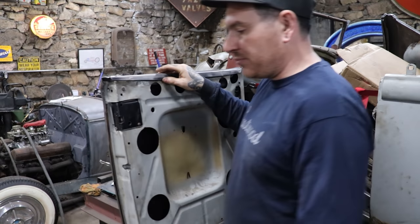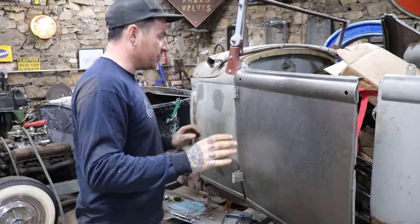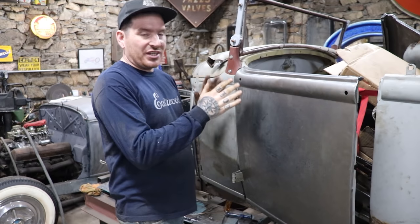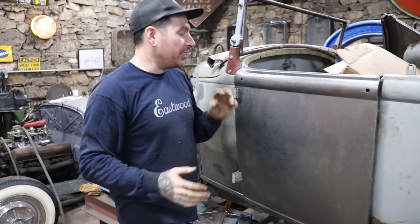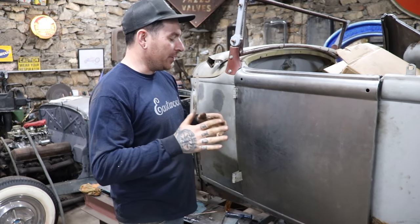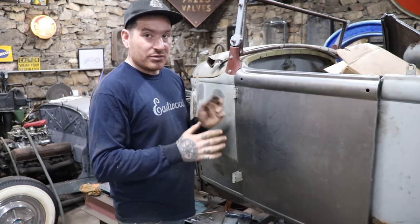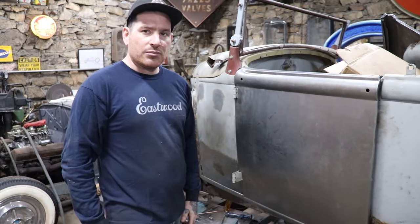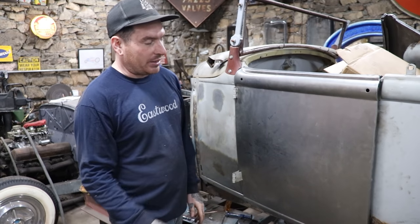So I got the door skin in and I'm pretty happy with how it all fits. The first place I'm going to actually start hammering over is in this corner here. The flange that's sticking out is actually hitting as I'm trying to close it and causing a little bit of binding. So I'm going to hit that over first, check it, make sure that it swings and fits okay once that's hammered over, and then we'll keep working our way. This edge here definitely is hanging up and causing a problem, so I want to start hammering on that, make sure everything clears, make sure the door gap stays pretty good.